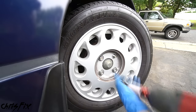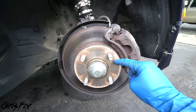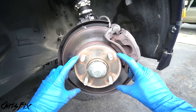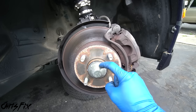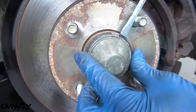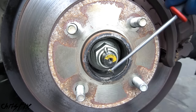Let's start with the front wheel — remove all four lug nuts and slide the wheel under the car for extra protection. Now we're ready to get to the four lug hub to replace it with the five lug hub, which also comes with a brand new bearing. To get to the hub, remove the dust cover — wedge a screwdriver behind it and give it a twist, it should pop right off. Then we have access to the spindle nut. There's a cotter pin in the way first, so pry the ends straight and pull it out with pliers.